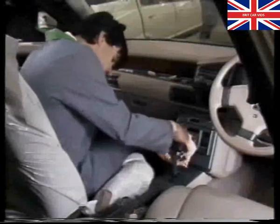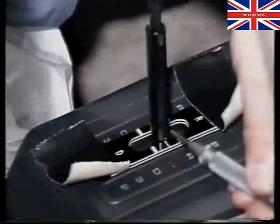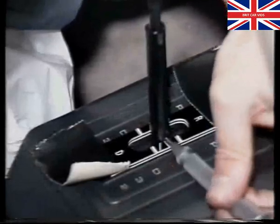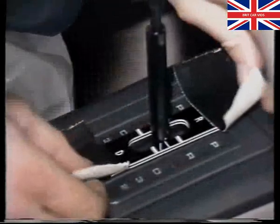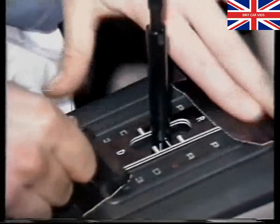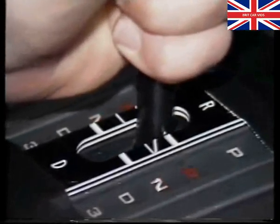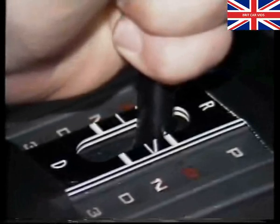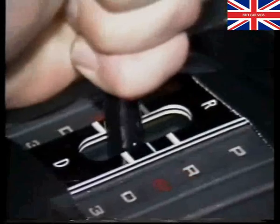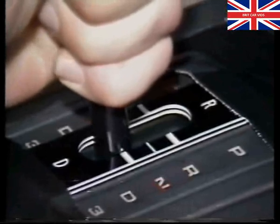Before driving the car, carry out a full selector cable hydraulic engagement check. First, select neutral and remove the handle. Slide the gauge over the lever, then centre punch the lever as near to its centre line as possible. Align the centre line of the gauge exactly with the punch mark on the lever and secure it in place. Apply both the foot and hand brakes, then start the engine. Push the gear shift slowly towards reverse until you feel the first point of engagement — the punch mark on the lever should be within the reverse tolerance band on the gauge. Now pull the gear lever slowly rearwards towards drive and check that the first point of engagement takes place within its tolerance band.